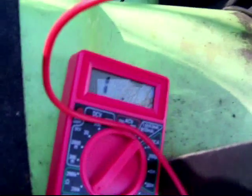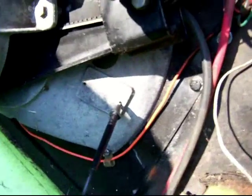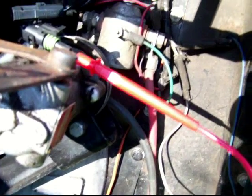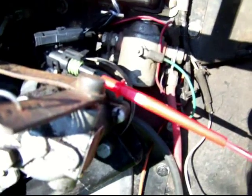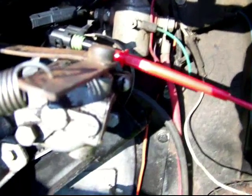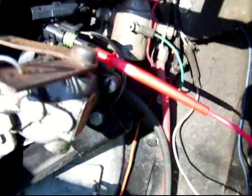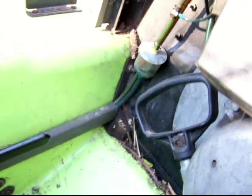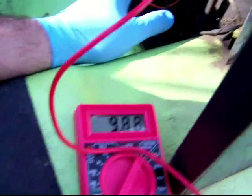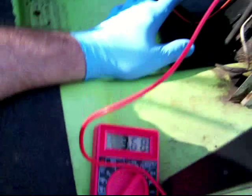and it's showing the wrong number right at the moment because I'm not applying any pressure to that ground probe. But doing resistance, it doesn't matter whether it's red or black, whichever probe goes in what direction. Basically, we're doing a continuity check. The points are aligned so that they should be closed right now. I did that by rotating the crankshaft on the engine, either through the hand start or under the hood by turning the cooling fan. So anyway, I'm going to just apply a little pressure here, just very slight. And that'll make the VOM read out.